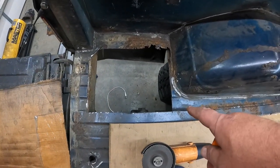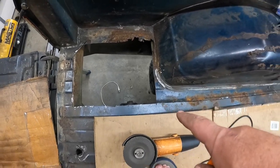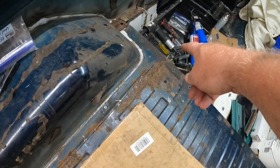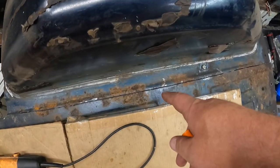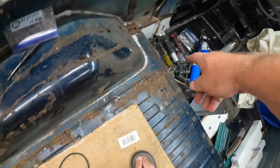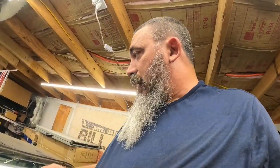across. Now I went ahead and cut this little section out, and you can see I ran this top part of this rib all the way up to the front. Careful not to get too deep because you've got a cross member here, and there's one somewhere in here, and then there's one right in here. And up there, I tried to stay shallow so I didn't get into the header on that end.